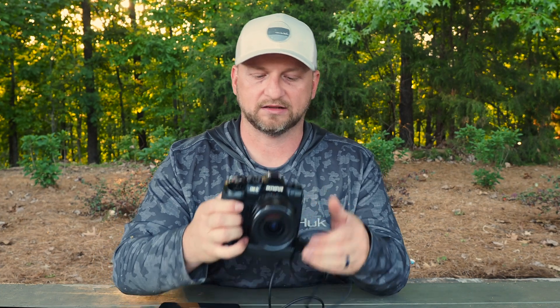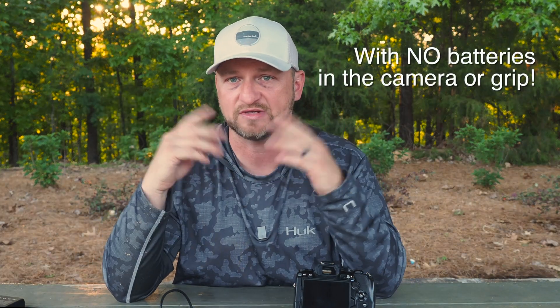Click the camera on and on the back we get a live view with no battery indicator. Now I'm going to move the camera up and show you the first test I did when I got it, because a lot of people are worried about the power supply coming into the camera — you don't want too much current or overheating. I've had no blackouts, no camera shutting off, and I typically don't shoot for long periods. I've had this setup run for up to an hour with no issues at all. The camera gets warm where the sensor would be inside, but no overheating or over-power delivery issues. I used some electronics to verify that what was coming out of the power pack and through the cable was rated in the 9-volt zone, and I'm going to show you that right now.